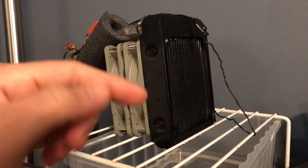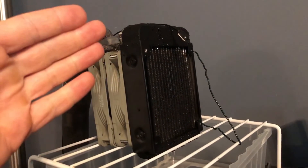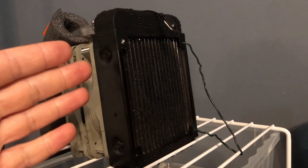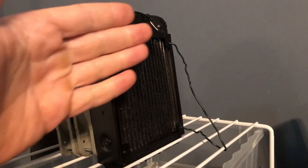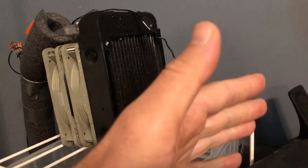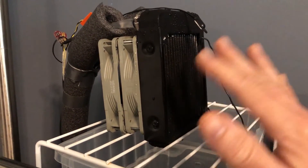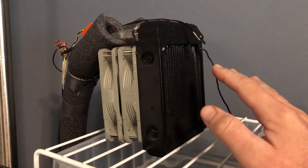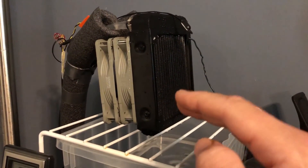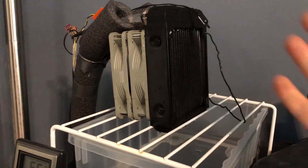If you let that chest freezer get down to its maximum cold temperature — negative 10 or negative 20 degrees — and pump that super-cooled fluid up through the heat exchanger, you'll have not only a ton of condensation but also freezing: the ice will clog up the little holes that airflow needs to pass through, giving you no airflow whatsoever. It might be okay to pump fluid as cold as around 25 degrees max, but even then you'll probably still get some icing. Also, do not put a salt solution in the water — that will corrode the aluminum shell inside. All the parts I've used will be in the video description below. Thanks for watching, hope that helps!